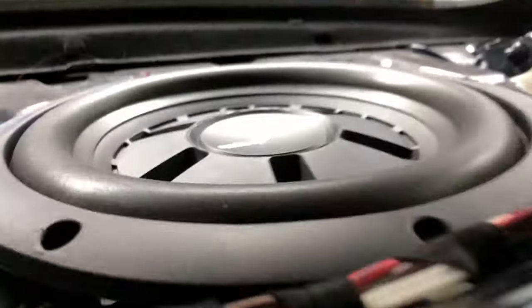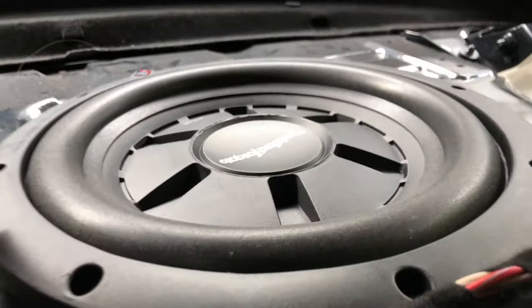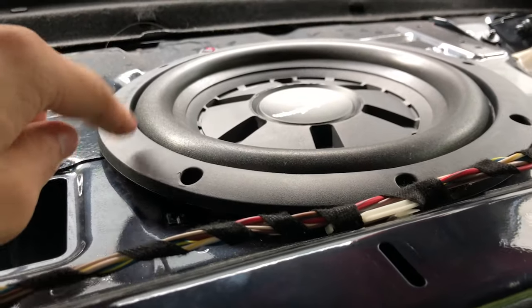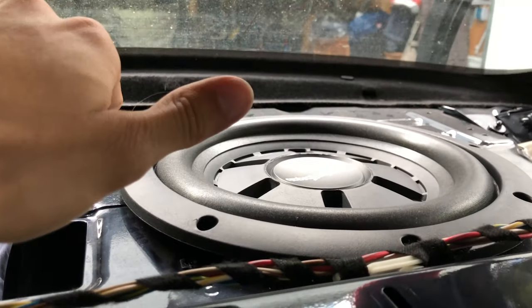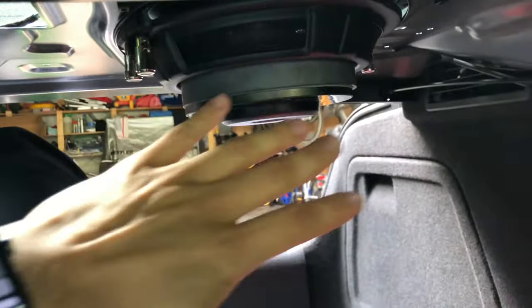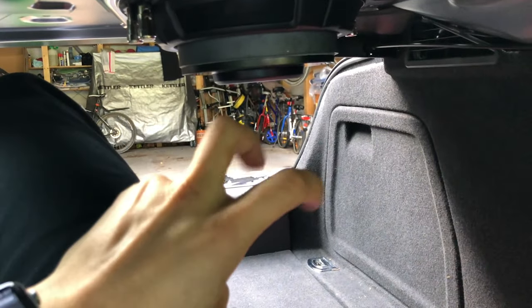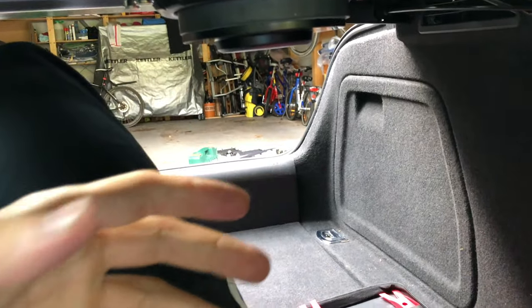What I have here is a Rockford Fosgate woofer. The exact details I will put in the description. I chose this woofer because it is, for one, 8 ohms. And it is infinite baffle compatible, which means I don't need a chassis under here, because it uses the whole trunk as an infinite baffle, as a large enclosure.